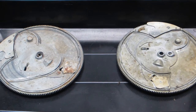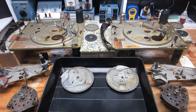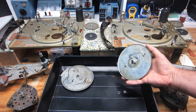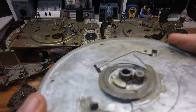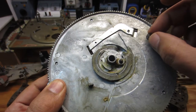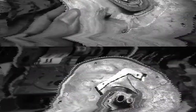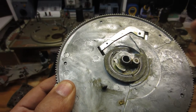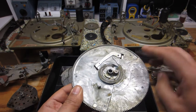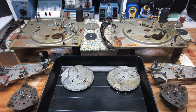And one more thing I will demonstrate here. Let me back out and bring the cam up into view. As you can see, I have the motors out and all that stuff. You can see how degraded the grease is — it's very, very degraded. It becomes really viscous, really thick, and that's the whole point as to why you need to strip these down and freshen up everything. Also, when you're going through, you're going to want to inspect everything — looking for any excessive wear, anything that's bent or damaged in terms of gear teeth or whatever.